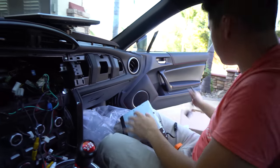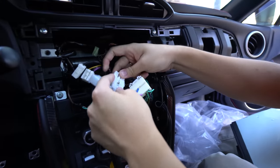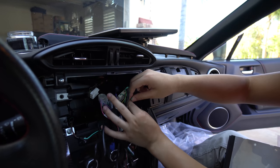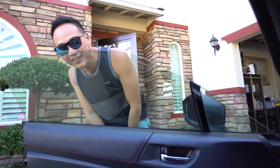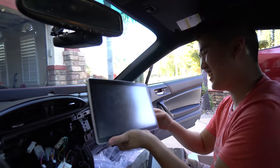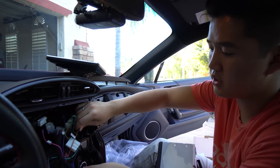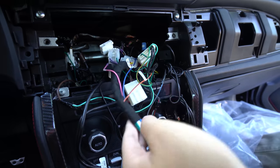I bought the pre-wiring harness so we can test it for the most basic stuff — it's just plug it in and then plug it in. So we got the reverse camera wire in. We plugged in these two main harnesses, but then we have the reverse in. The reverse camera is not plug and play — that's just how it is. Reverse cameras are probably usually the most annoying part. You have the reverse-in wire to plug into your reverse signal wire, so your head unit knows when it's in reverse. That's a big key.